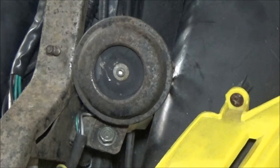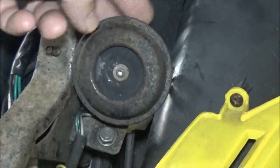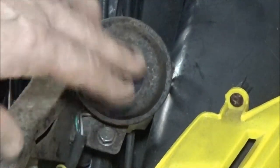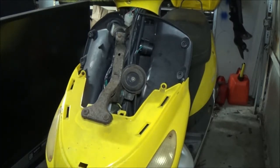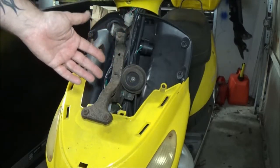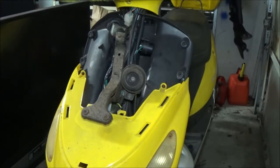That's all there is to it, really. If you can hear it clicking, first thing is make sure it's not rusted up or anything. If it's not, then try to pull that screw clear out, do some adjusting on it, and then go from there — maybe oil it up, won't hurt a thing. I know this one worked not that long ago so I knew it wasn't going to be too bad, just a real simple fix. Thought I'd share with you because a lot of guys will go buy a new horn, and they're not very expensive, but if you spend 10 to 20 bucks on a horn that you don't have to — you got some time and just a little bit of know-how. Turn signals working, alright, cool.